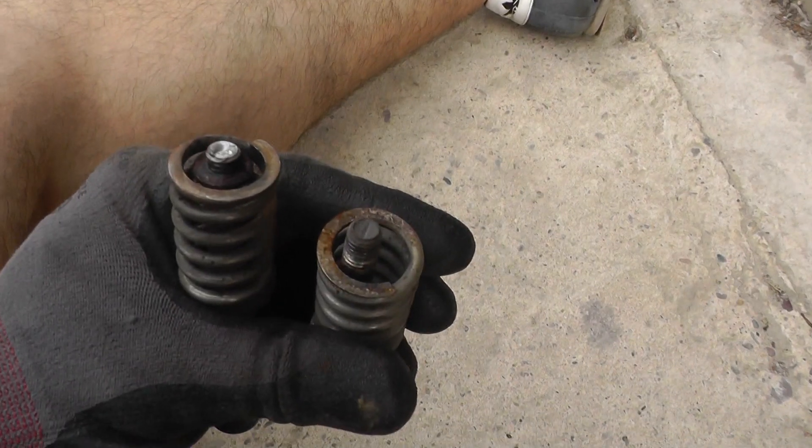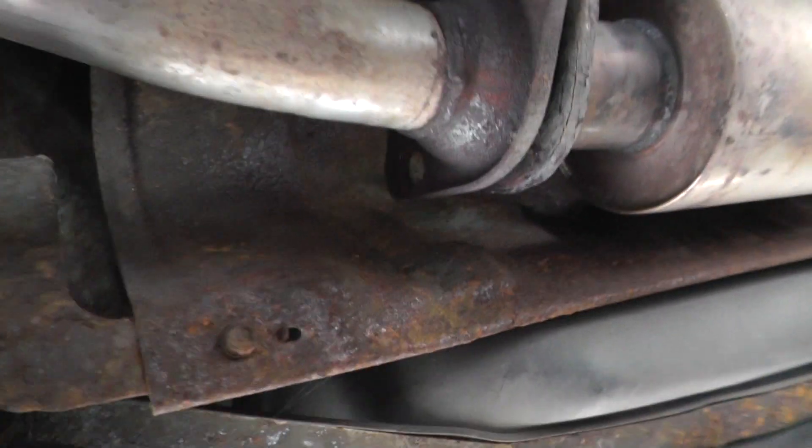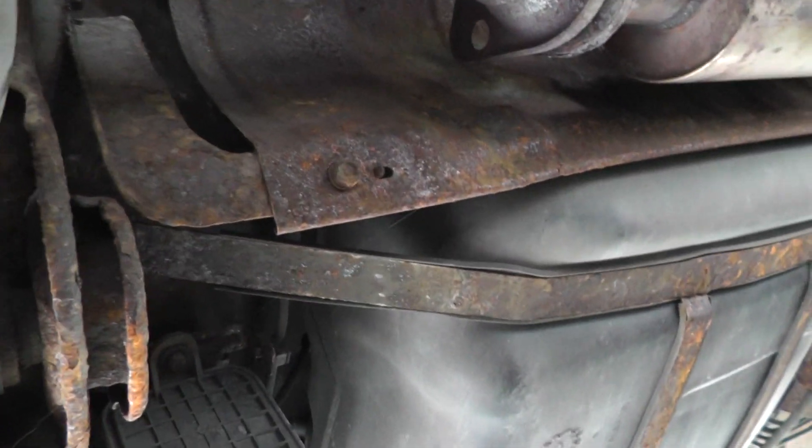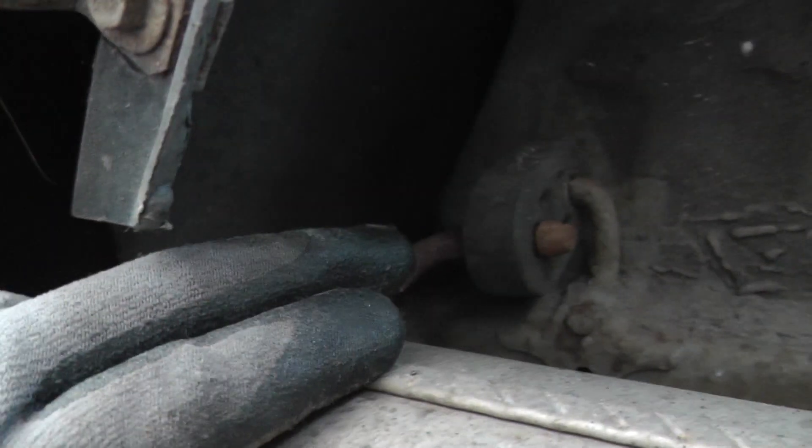Then you just need to push off the rubber mount. It should be willing to come out. I think it's actually got two mounts — one there and then there's one around here. It's very simple to do. One bolt came out but the spring bolt snapped — not a big issue, I'll show you how to get that out. The back box is pretty much ready to come out, and then I'm just going to get off these two hooks — one and two. I've got a special tool to do that with.